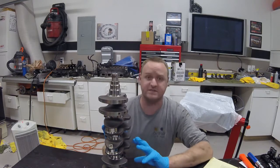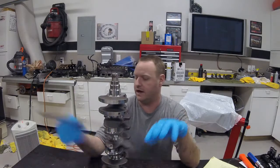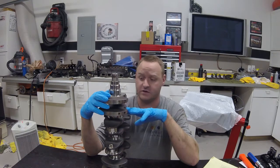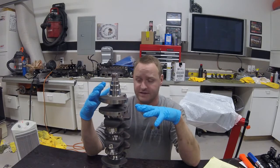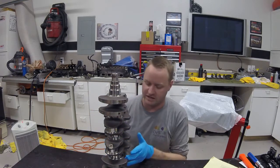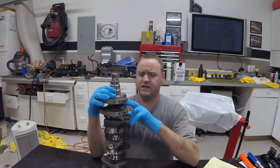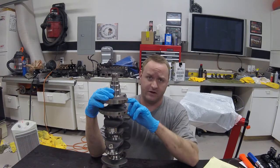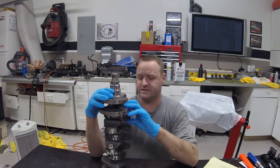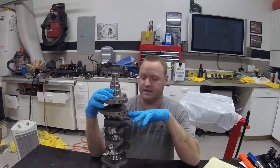Now I am going through and clearancing all my bearings using PlastiGauge — it's about six bucks at AutoZone or NAPA or wherever you like shopping. I'm just going to do that dry first to double check. All my clearances should be within spec with no issue, but I just want to double check as these are the core part of the engine. I am not going to do a video on the actual clearancing process because there are plenty of those online — there are several good videos on using PlastiGauge on YouTube to check main bearing clearances. Next you will see me cleaning the machine surfaces for the bearings in the bottom end of the motor and inserting the crank and getting the caps and bearings on.